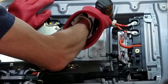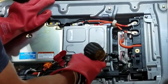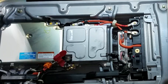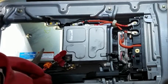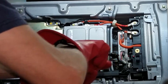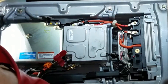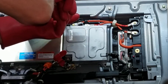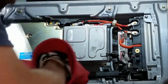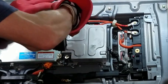Right now I'm just getting the four bracket bolts that actually hold this converter in place. Once we get those disconnected I'm just going to take some needle nose pliers and fish those out so they don't fall down in — or you can use a magnet or whatever the case may be. I'll leave a link below in the video description to the other video I did to diagnose the DC to DC converter on this Honda Civic Hybrid.